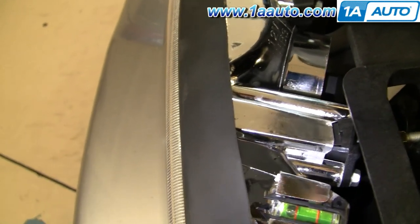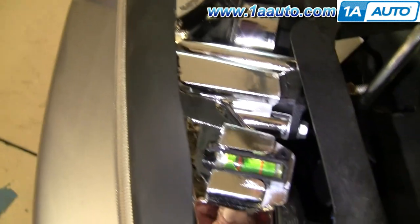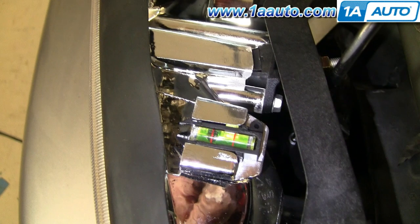It wants to go down a little bit. The car has to be on a level surface. Then comparing to the original light, right there on the line is about where it should be. Actually, the bubble — you might want to have it a little further forward.